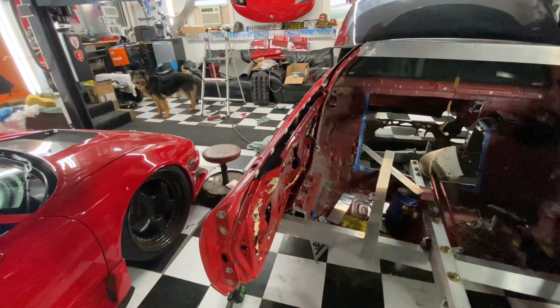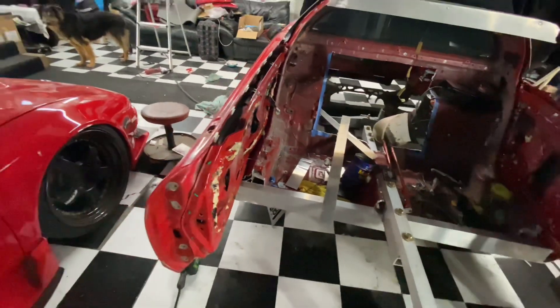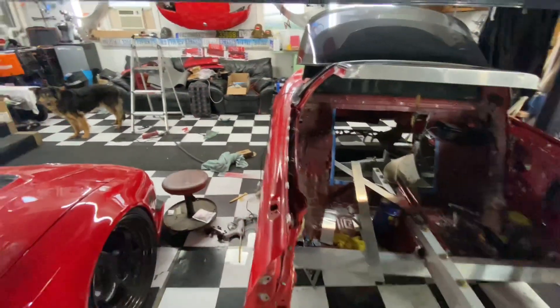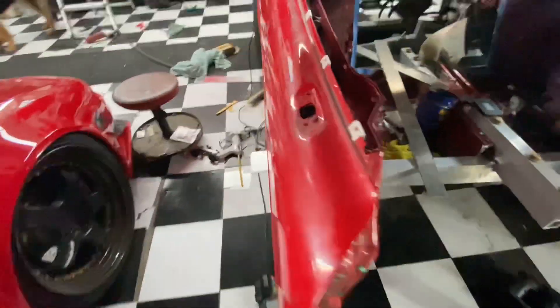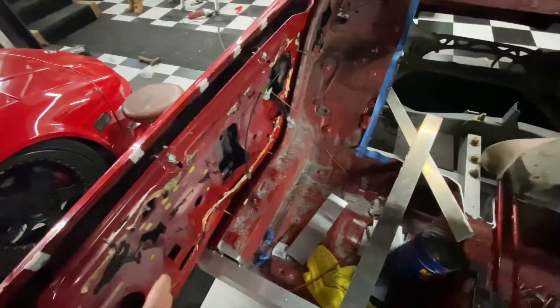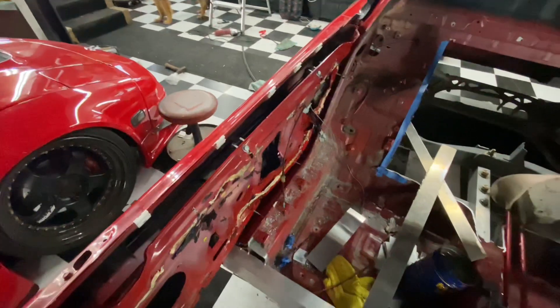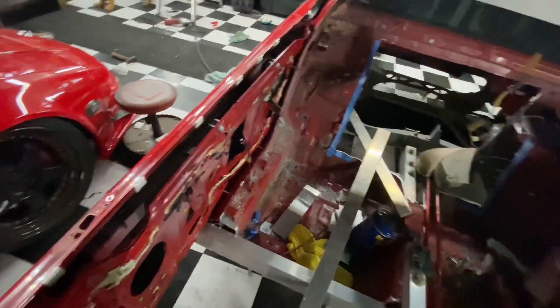It's a new day and we're back out here in the garage. These doors have the factory latches so I was able to latch them on the car so they don't fall off, but getting them to line up is another story. Usually there's interior door cards and weather stripping. I lined them up the best I could, then drilled holes and put carriage bolts through. This doesn't keep them from wiggling, but it puts them in place so I can weld them. I'll need to make brackets that hold this in place so it can't move up, down, left, right, or out.